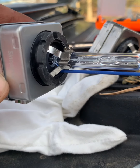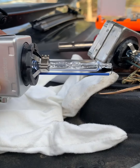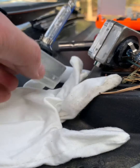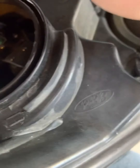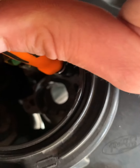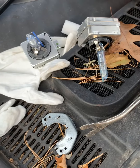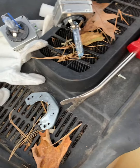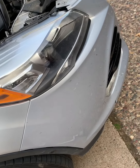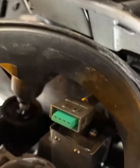What I did too, once I got the light bulb out, was I took a magnetic bit and used my camera phone to go in there, kind of used it like this to see where I was going, and then get the housing out. Just FYI, again — 2014 Ford Escape with the HIDs — without removing the whole headlight assembly and the front bumper, that's how I have come to get it out so far.